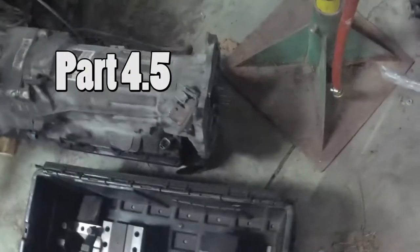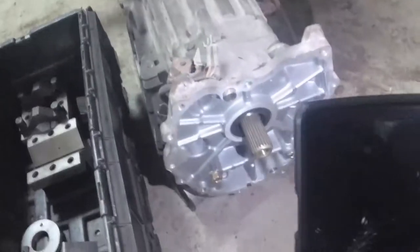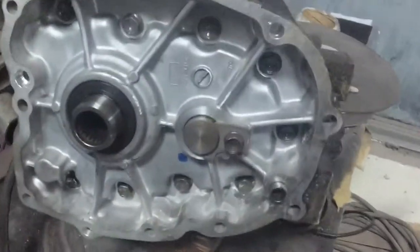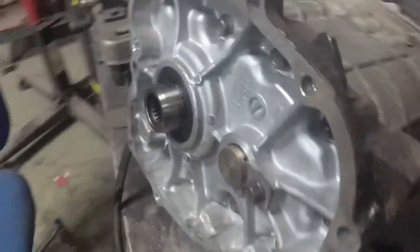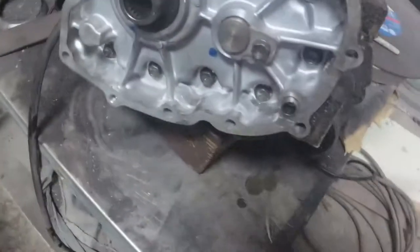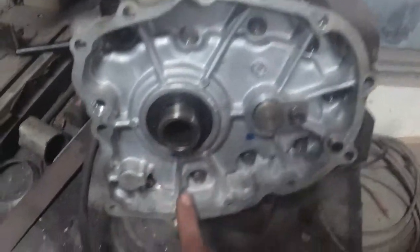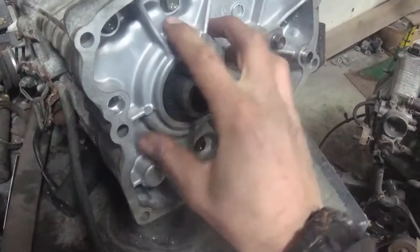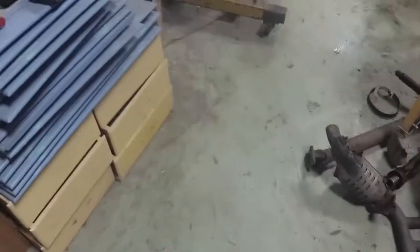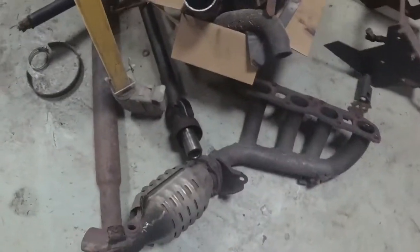This time we are going to be dealing with the transmission. We have got to make a plate — well, not make a plate — but we are going to take the transfer case apart a little bit. We are going to unbolt the end; it looks like this whole thing should just separate right there. We are just going to unbolt all that, and hopefully be able to use this shaft with the bearing and seal. The end of the transmission will be fine; we are going to adapt the other end of the input shaft to take this motor, so it will take that drive shaft.